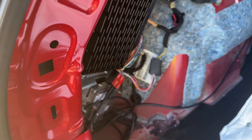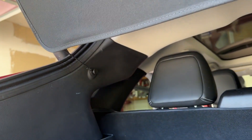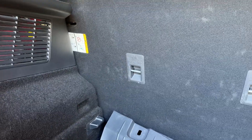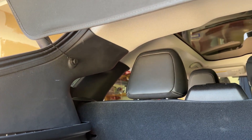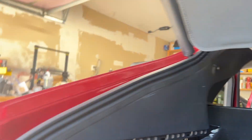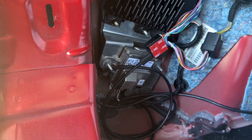We've got to take this cable and get it all the way up to the windshield. The key point is you want to go up under the headliner. If you go down under the doors, you're going to need about 18 or 19 feet of cable, whereas if you go up through the headliner, you'll be able to get there in about 15 feet. I've got 16 feet of cable and probably a foot and a half coiled up.